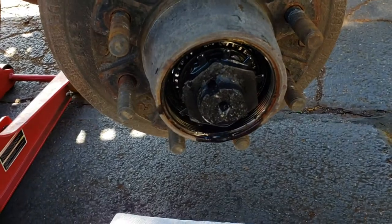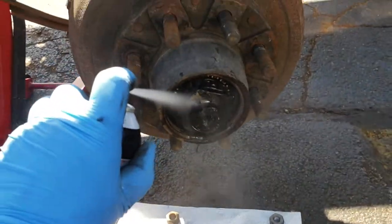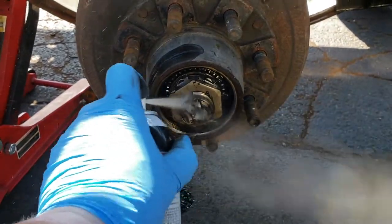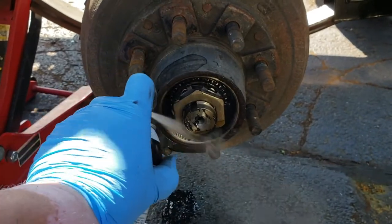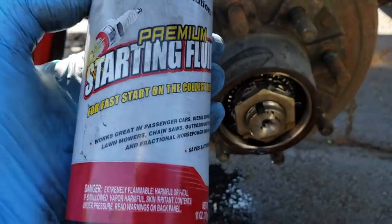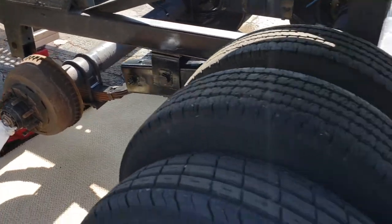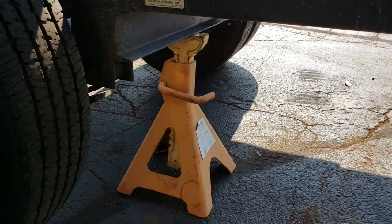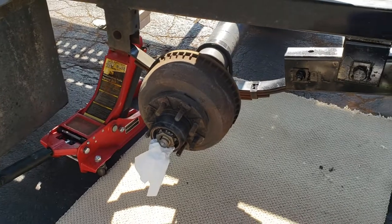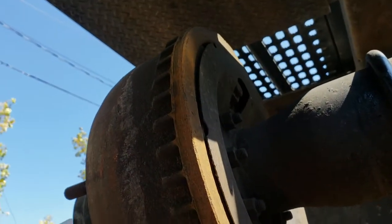Before removing the nuts, I like to do a little cleaning using starting fluid — it's a very good liquid for cleaning dirty parts. This keeps tools cleaner. As you can see, the grease and oil gets removed, and the parts dry up fast since this fluid dries quickly. Before going under the trailer to release the shoes, make sure you install a floor stand under a really strong beam to hold the trailer, just in case the floor jack fails.